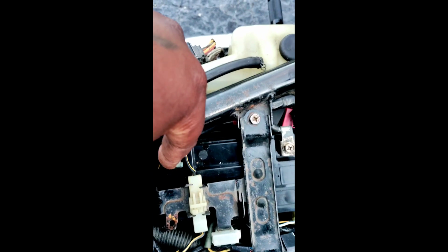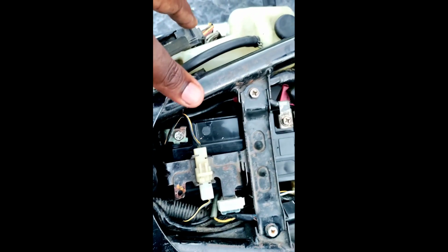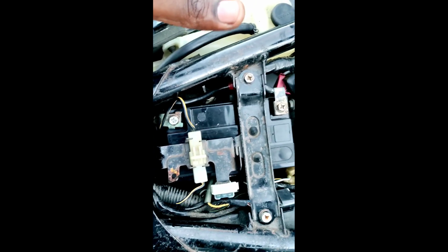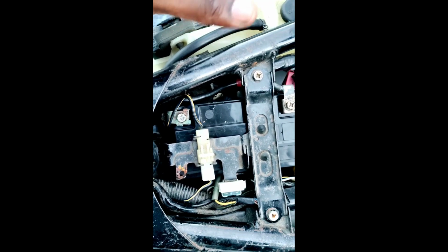And then actually, this is a different battery. I put a brand new battery in. My negative side over here actually melted, okay? You could clearly look at it and see that it was off. You want to check your battery as often as you can, guys, because that's something that could have started a fire.